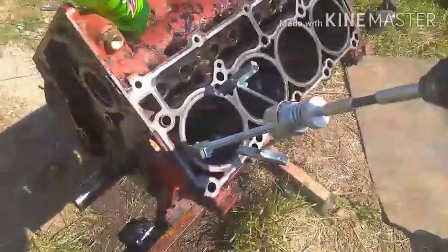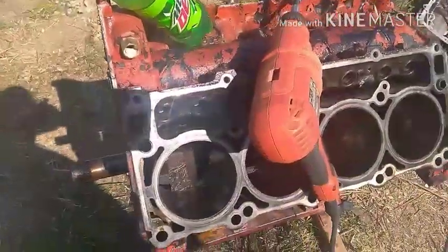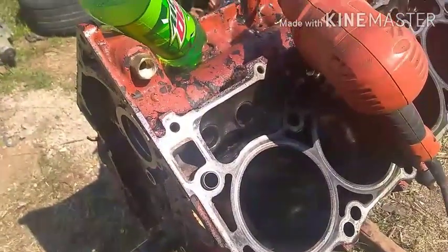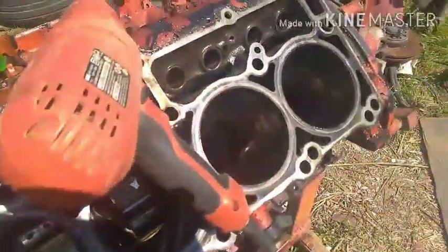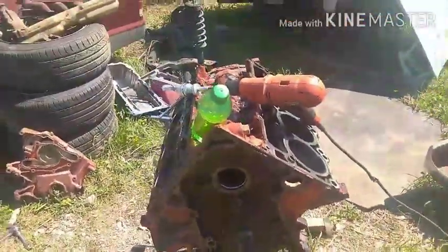You put the stones in the hole, you move them up and down as you're spinning it. If I remember correctly, I think you're wanting somewhere around a 45-degree crosshatch. I can't remember the exact measurement - I know what it's supposed to look like. I've been doing this by memory and eyeball mostly for a while. I'll show you more when I have more to show you.